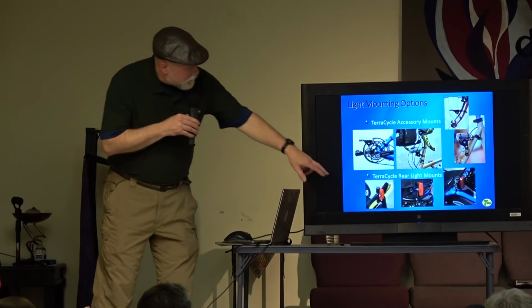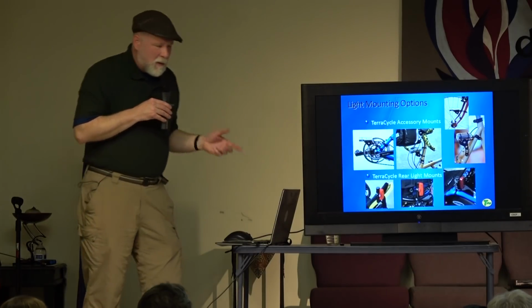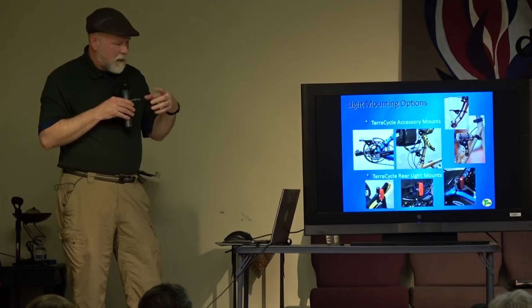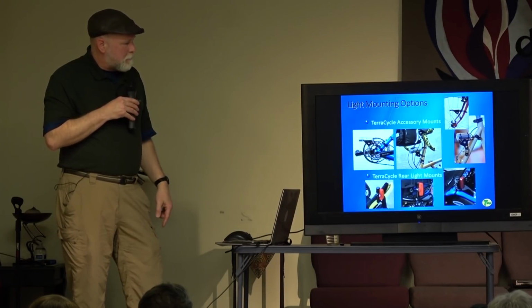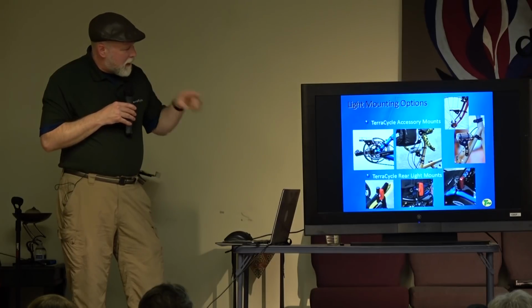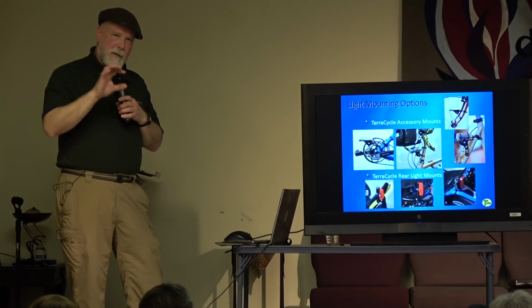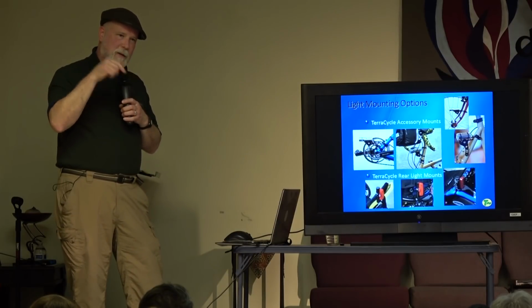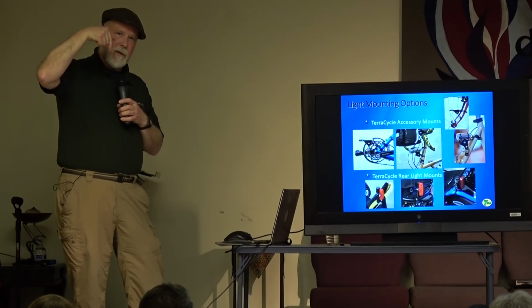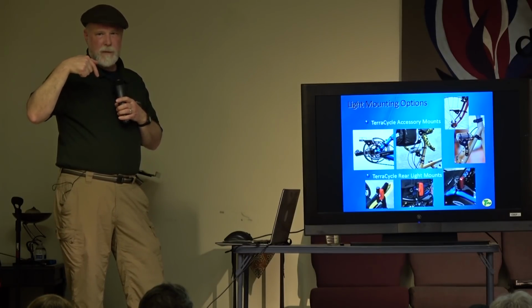And then for the rear, we make a new thing. It's a super simple thing with two plastic clamps that are kind of back to back to each other and holding a short tube. And with the combination of being able to rotate the plastic clamps around the tube you clamp to on the back of your bike and rotating the clamps around each other, you can always get a vertical post no matter what the angle of the tube is that you put it on.